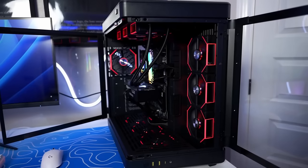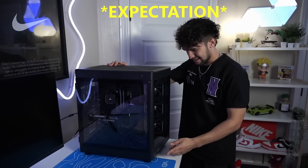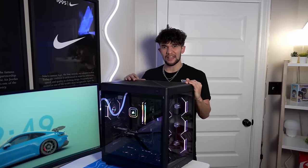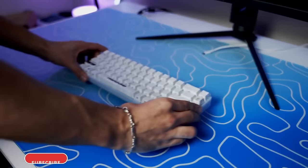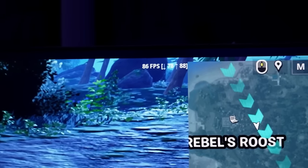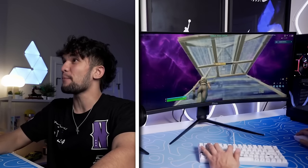It booted! It actually looks so sick. I was expecting to have to fix something and have it not boot right away, but I guess that means I did a decent job at building this. I want to test the most important part of a gaming computer — how well it can run games. I threw a quick setup together, downloaded Fortnite, and got right into it. In Creative I'm getting between 110 and 120 FPS, but in an actual game I'm averaging 90, which isn't exactly wonderful, but this was all tested on DirectX 11. Switching to performance mode, Creative is at a whopping 300 to 400 FPS — making that switch from DirectX 11 to performance is a night and day difference. In a regular game it's averaging between 200 and 300 FPS, which is much better and definitely numbers you can't complain about on a $1,000 build. Rating this PC strictly off performance I'll give it an 8.5 out of 10, but including the way it looks — which is beautiful — bumps it up to a 10 out of 10.